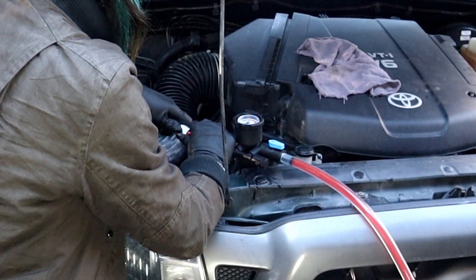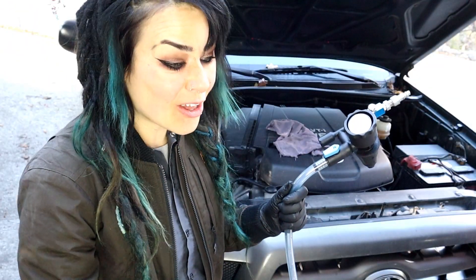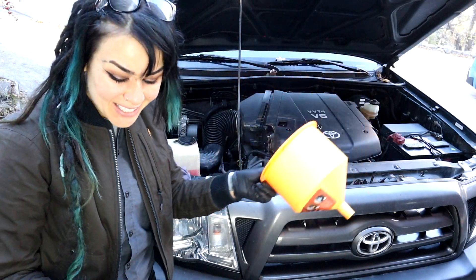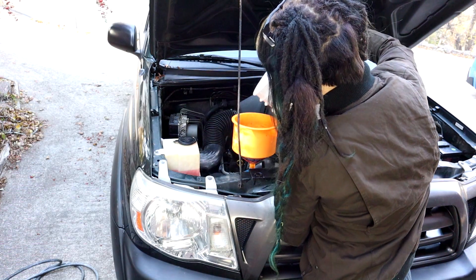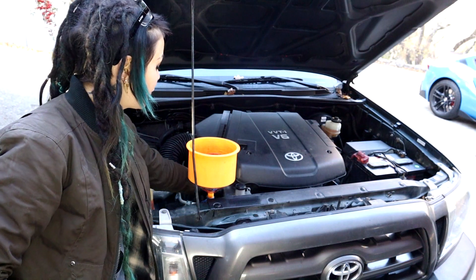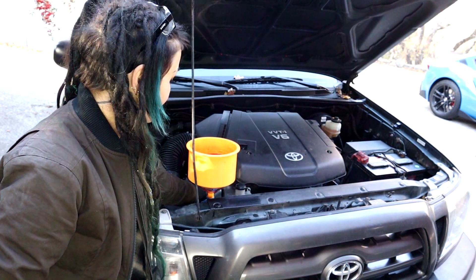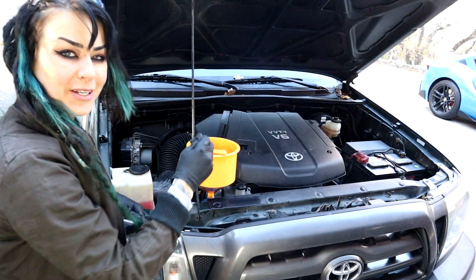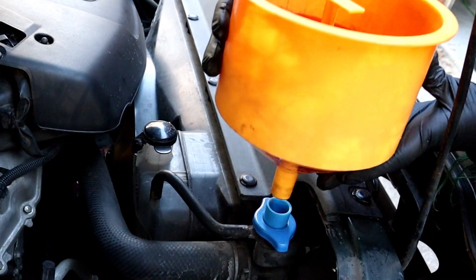So now I'm going to disconnect my air hose, set that aside, and take this and drain the hose back into the bucket. Then I can just take my funnel, put it on top of my coolant jugs, and empty the remainder of whatever's left in the bucket back into my clean coolant containers. I will, however, still use this — as shown in my previous video — to do my final little top-off. And then once it's filled itself up for the most part, I'll also give the upper radiator hose a squeeze to see if I can massage out any last little air bubbles that might just be caught in the upper part of the cooling system — but usually not. One of y'all taught me this trick in my last video: before I go ahead and stick the plunger in and leak a little bit of coolant out, I'm going to squeeze the upper radiator hose, then put the plunger in and lift it off — and that will spill no coolant.